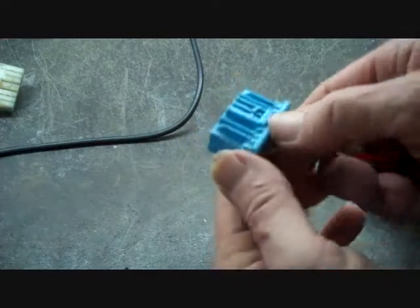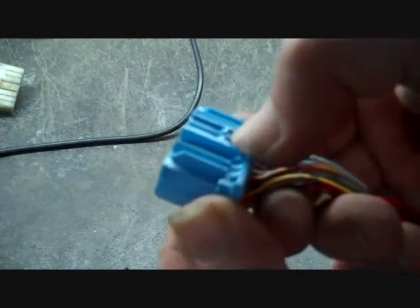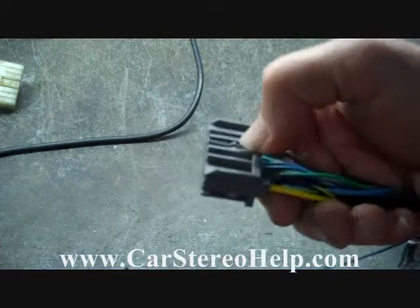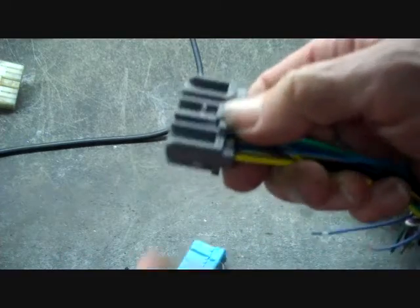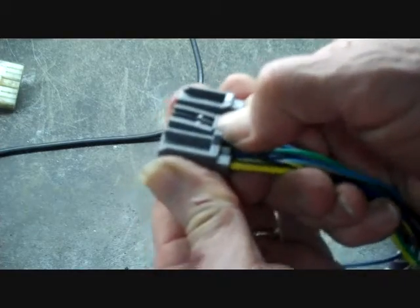Now this main connector has a trigger on the top — you can see the little hooks right here. These hooks go in and lock the connector into place. To release that, you push this trigger down and it lowers the hooks. This goes for most connectors. This is a Chrysler connector — it also has little hooks sitting right in here and a lock at the back. You push this clip down and it will release the connector when wiggling loose.